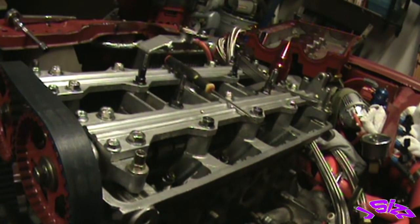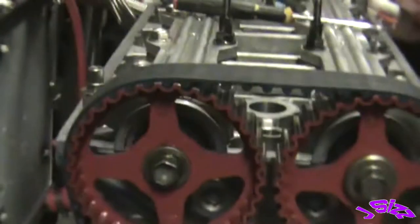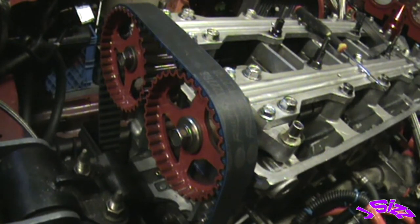Good. So now it says to rotate crankshaft 180 degrees. Camshaft pulleys turn 90. The up mark should be on the exhaust side, pointing to the exhaust. So we're gonna get our ups to point left. Oh, man, these springs are crazy. Yeah, hopefully my bolt doesn't come loose on this thing after hitting it with the air. Gonna loosen the bolt. And there goes the bolt. Let's see if I can't tighten it up now that I got a breaker bar on it.